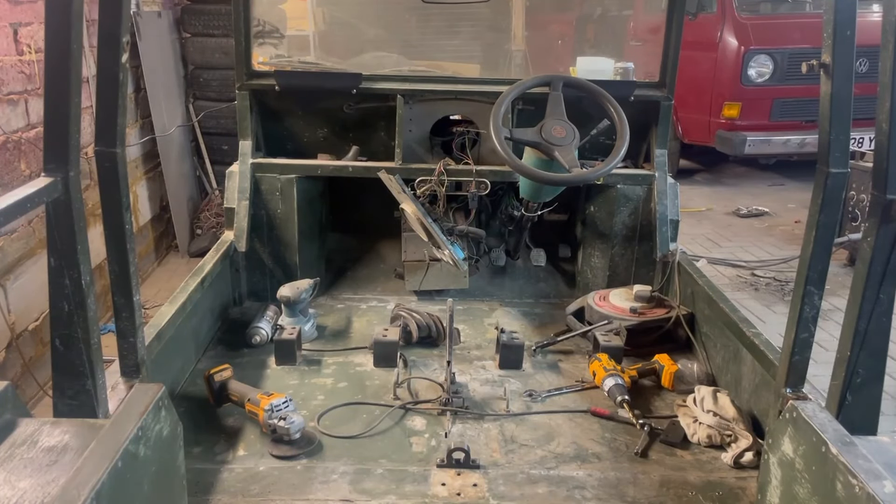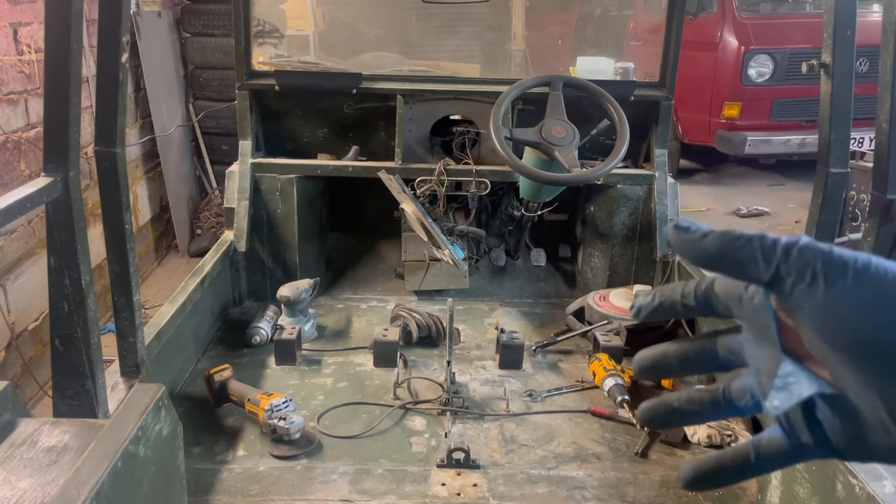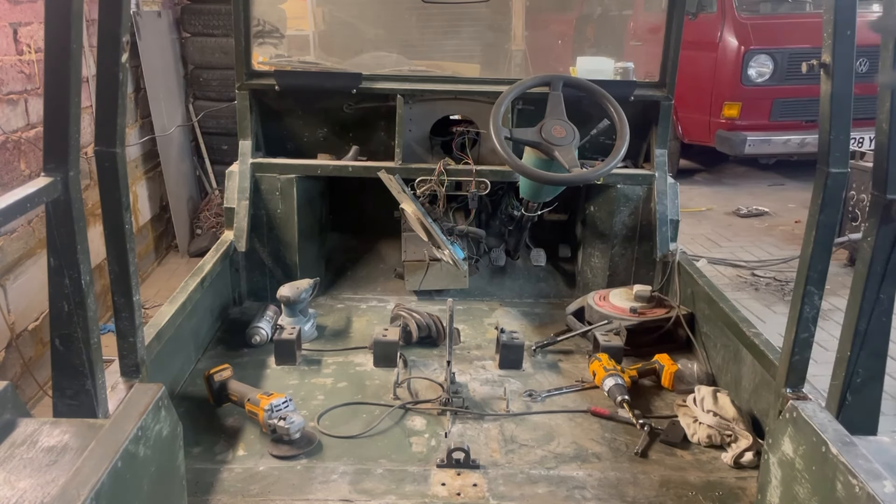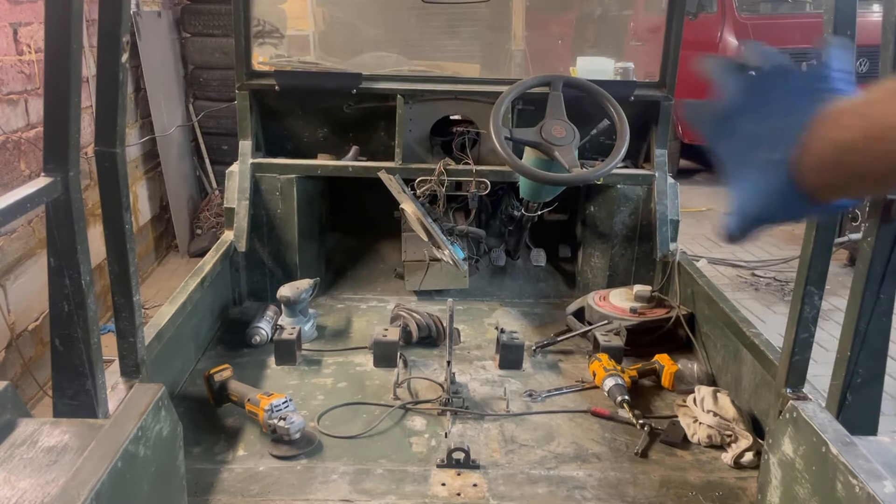Passenger side seat belt removed. Redrill the new mount in the correct place for the fuel tank - it'll all be hidden underneath the mount anyway, so it's all good. Now take the dash bits out, and I'm thinking I'm going to take the heater out as well, because it'd be easy to stone chip all that area. I'm thinking of replacing it with just a little 12 volt heater, because the heater is actually more useful for helping cool the engine on a hot day than it is for de-misting and heating the car.